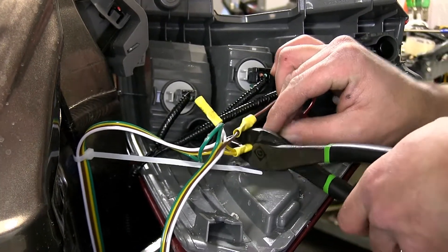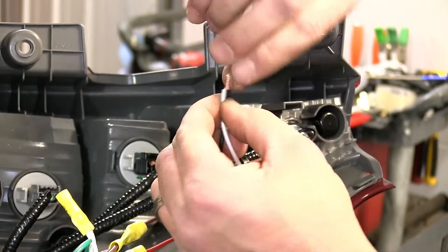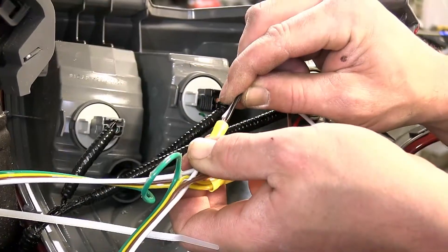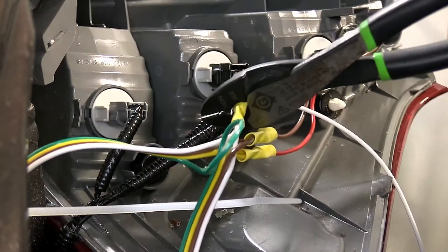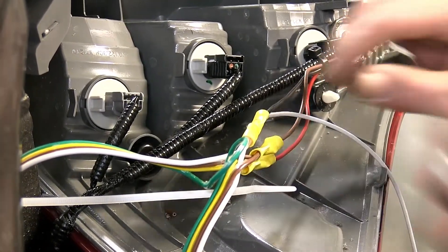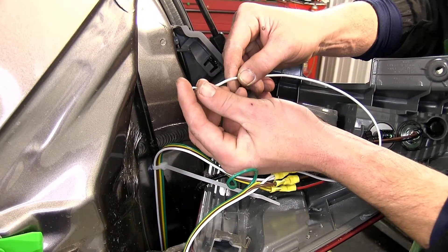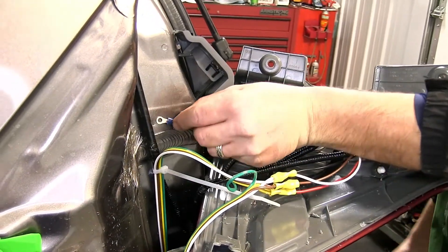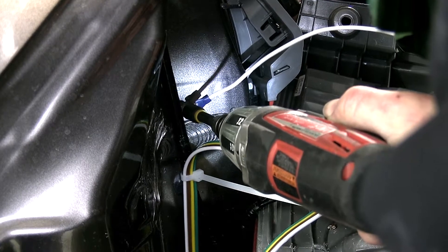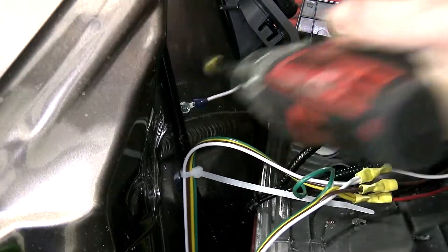Here on the driver's side, before we connect the black wire to the white wire for our ground, we'll add an additional piece of white wire — taken off the four pole harness — to our black wire, twist it together, and then connect it to the white wire that we ran over from the passenger side. We'll take the other end of the additional white wire, cut off any excess, strip it back, and add the blue ring terminal provided with our install kit. We'll use a self-tapping screw to make this connection. I recommend finding an area where the sheet metal doubles up for a more secure ground — here behind the tail light assembly is a good location.